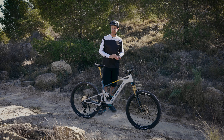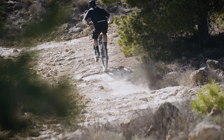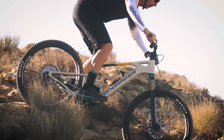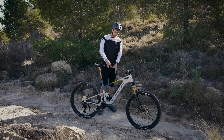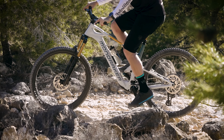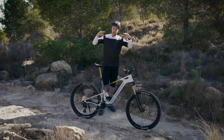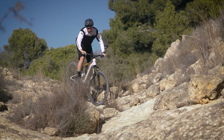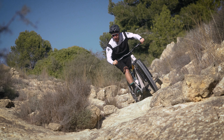If you don't have enough sag, your bike's going to feel very firm and very harsh — definitely not as the suspension designers intended. If you ride with too much sag, not only is the bike going to sit very low to the ground and you'll be risking striking your feet on rocks as you're pedaling over steps and things, but also the suspension units will be sat in a point of travel where they're not reacting properly. So you'll find the bike just feels wallowy and doesn't feel as it should. Spend the time getting the sag correct and your bike will perform brilliantly.